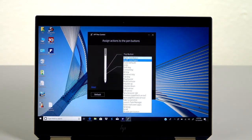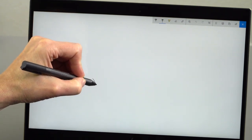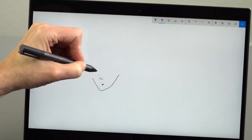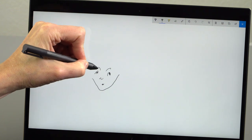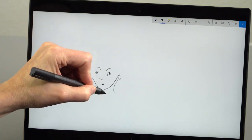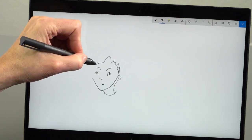It's HP's usual N-Trig-based digitizer that we have here that they use on their consumer line of laptops, and it's a decent enough technology. You get your 4096 levels of pressure sensitivity. Nominally, it's supposed to support tilt, like I said. With the HP consumer line using N-Trig, the tilt is pretty hit or miss. The Elite x360 definitely has more effective tilt, and then you can go up to something like the ZBook X2, which uses Wacom EMR, woohoo, the best of the best, and certainly has tilt.